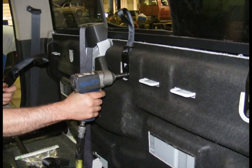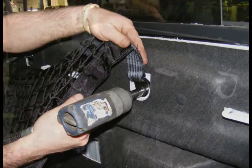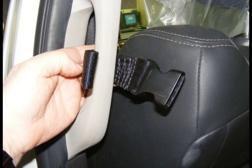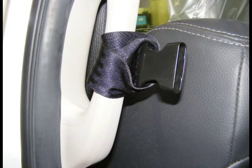Net Install. Lay the net across the bed frame, making sure the buckle inserts are toward the front and anchor plates of the net are to the rear wall of the cab. Remove the existing child anchor safety straps. Attach the net strap anchors to the three existing child restraint anchor points with factory restraint bolts, making sure the strap is in the up position. To attach the side strap net connectors, simply pull the latch through the loop tying it to the handle. The front buckle inserts simply click into the corresponding buckle on the frame.